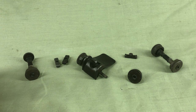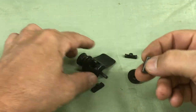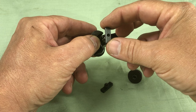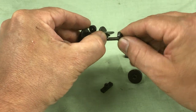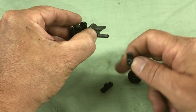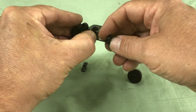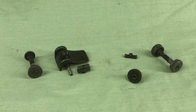I just want to give you that little rundown because people are getting stuck and I don't want that. The last thing to say is: don't try to force a rounded type 2 lock bar onto a later pinion — the threads won't work. You're going to screw up the pinion, the nut, or both. The square lock bar is required for the later ones. Alright folks, take care, subscribe, and have a good one.